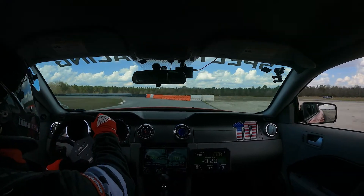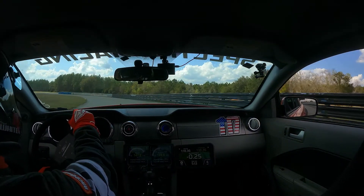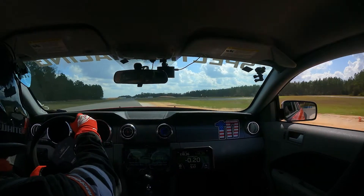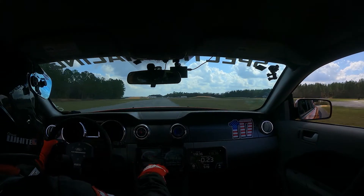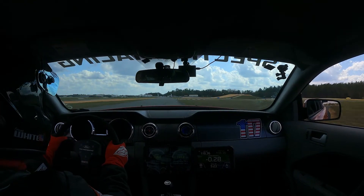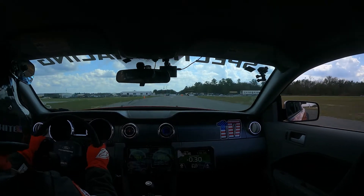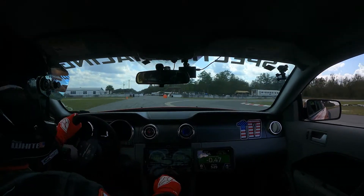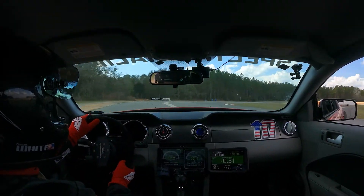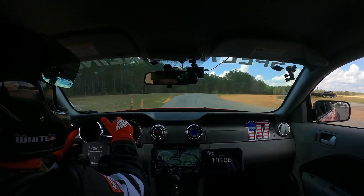In some testing at autocross and the track itself, I tried a couple of different fan configurations — kept the two fans sucking air down through and out the license plate, tried some bigger booster fans — but basically using fans wasn't creating enough airflow through the heat exchanger. I obviously needed to get some high-speed outside air through the system.